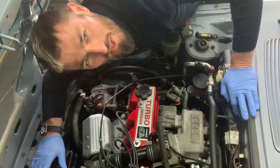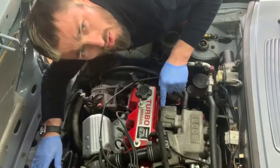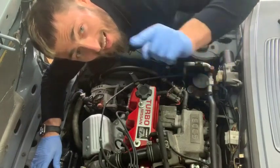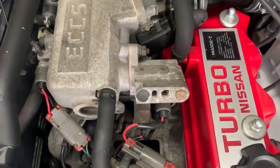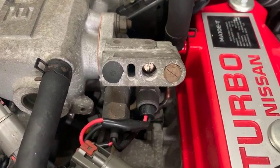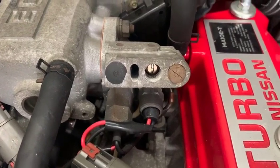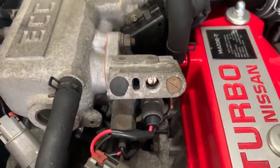One of the most common questions I've been asked over the years about a Figaro engine is: what do those three screws do at the top of the engine? Two of them you turn and nothing even seems to happen. They're actually really handy. These three screws are part of what's known as a compensation system. What they do is change the idle on the car when something's putting a draw on the engine — that might be the alternator, the steering rack, or the lights. These screws allow you to adjust that compensation to bring the idle up so the car doesn't stall.